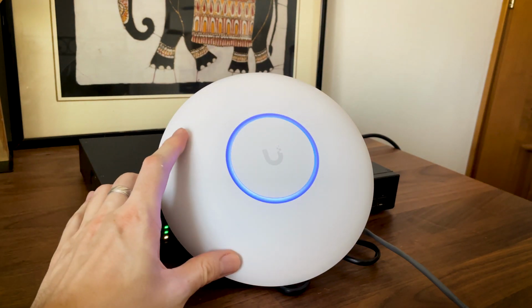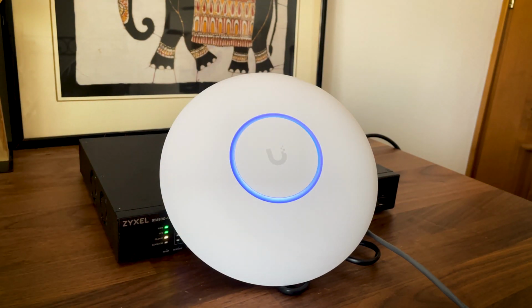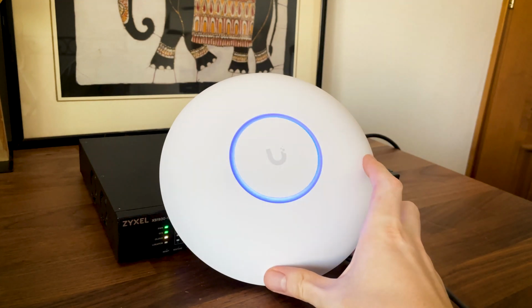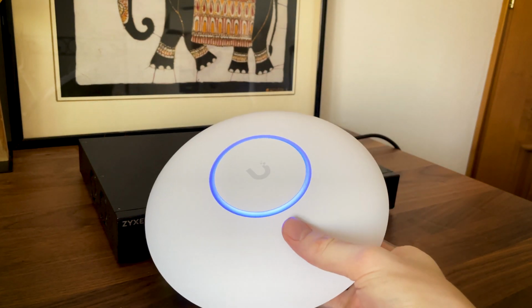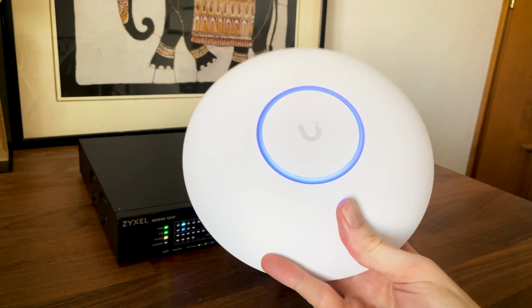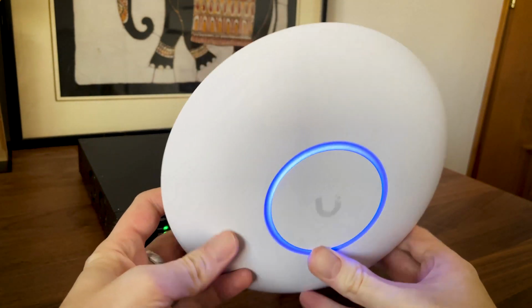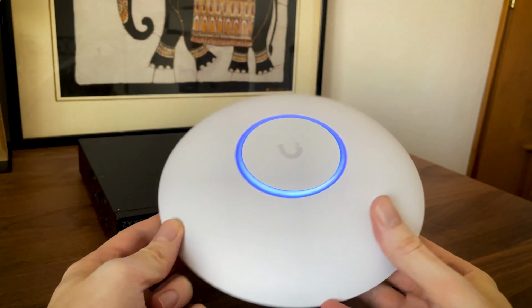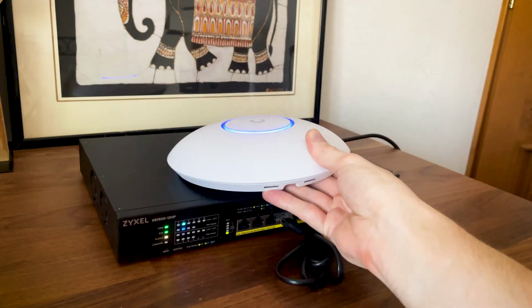improvement on the single client test, especially when I was farther away from the access point, but that's mainly using the 160 MHz with the 5 GHz radio band and the 320 MHz channel bandwidth. Using the 80 MHz width, the throughput didn't budge that much. As for latency, I did see some clients doing slightly better, but overall it's not a significant improvement. So there you have it. Make sure to disable the wireless meshing if you're not going to use it, since it's an opt-out feature instead of opt-in. Ubiquiti should have known better.